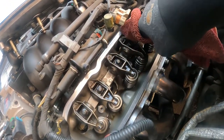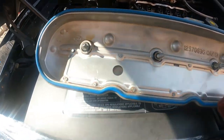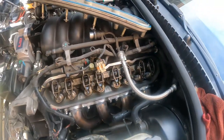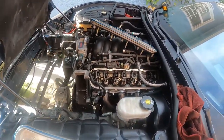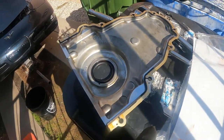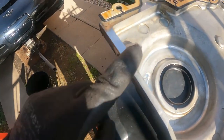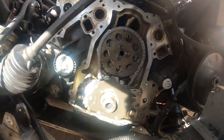What I did: I set the rocker arms to zero lash, which means you tighten the rocker arm until there's no up-and-down movement — just side to side. Then I rotated the motor, watched the rocker arm go down and come back up, rotated a little more to make sure I was on the flat spot, then tightened the rocker arm to 22 foot-pounds of torque. Then I cleaned the surface — removing any grunge — to make sure I had a clean contact for the gasket.